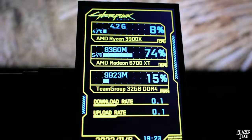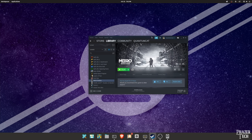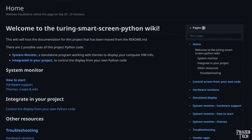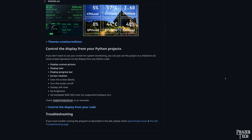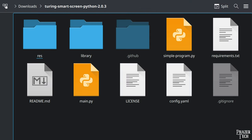Everything looks right on target. The GPU load is much higher now and temperatures are going up accordingly. CPU load is moderate, which is what we'd expect. I'm not really sure what issues Jay was running into, but it was simple enough for me to figure out. Now let's try it with Linux. You'll need to download the Turing Smart Screen Python library — linked in the description. Be sure to scroll down to the bottom of the GitHub page and click troubleshooting for the serial port permissions command. After that, you can run main.py to launch the performance monitor.